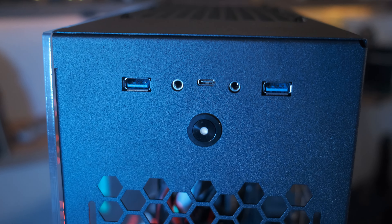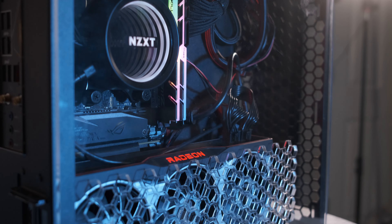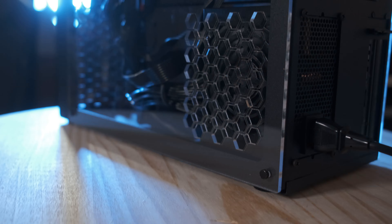I also wish the audio ports in the front were labeled in some way — the right is input and the left is output, but since my headset is 3-pole none of them really works for me. The acrylic panels on the side give you a great view into the case, but on my unit there is still a small gap in the middle of the panel, similar to the issue on the S402. Upping the screws from 4 to 6 would have helped mitigate this. The PSU side panel is significantly smaller than the main panel, giving the case a non-symmetrical look. You can custom order a full-size panel if you want symmetry, but the screw placements would stay the same.